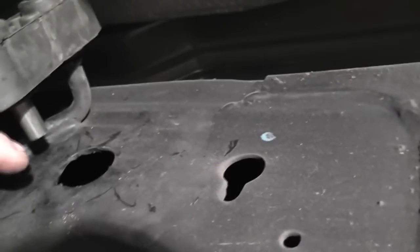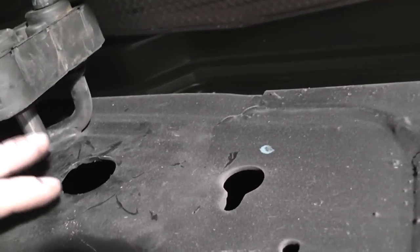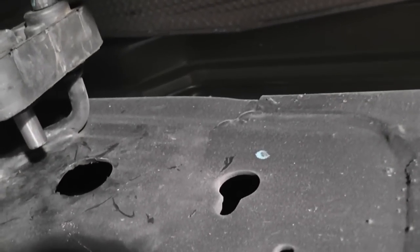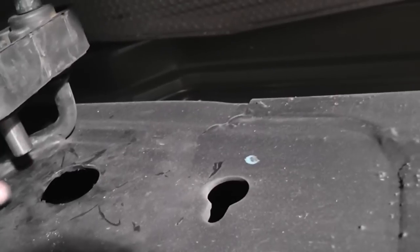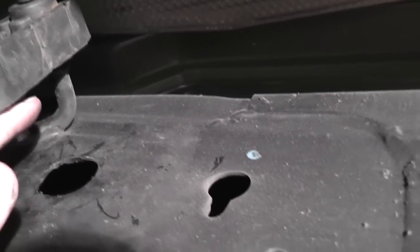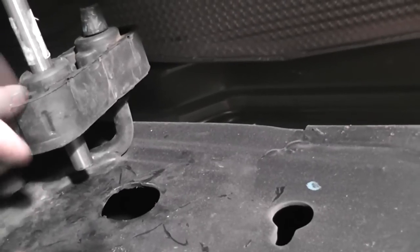I needed to find three quarter inch clearance, and with the inlet on the outside of the vehicle it actually touched the frame — so that's bad. But spinning it around, look at that: I've got all kinds of clearance. What I've got left to do is put my clips on here to lock the hangers in on this one and the others, and I'm done.